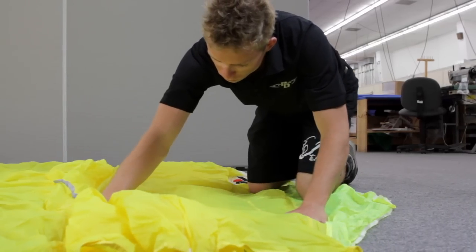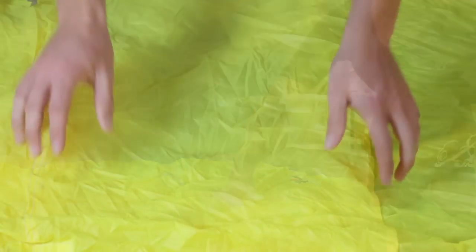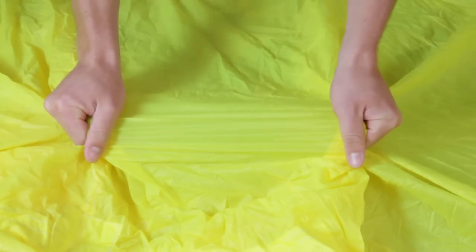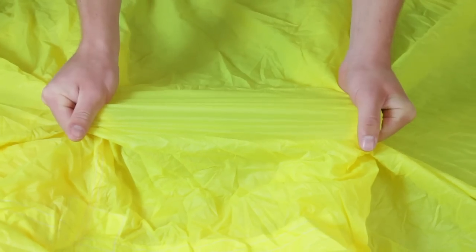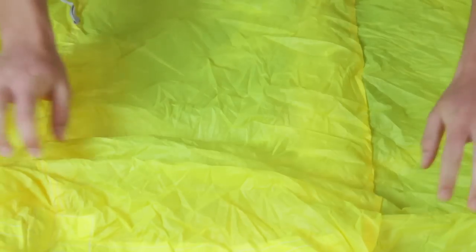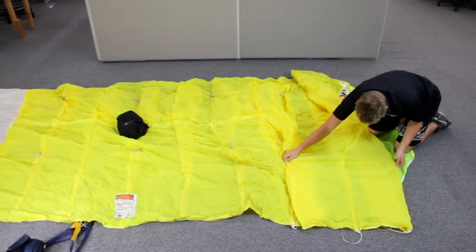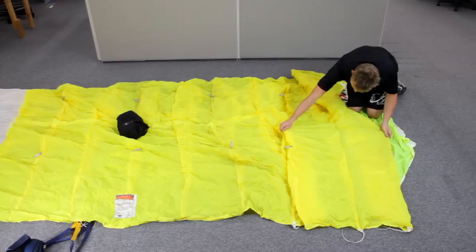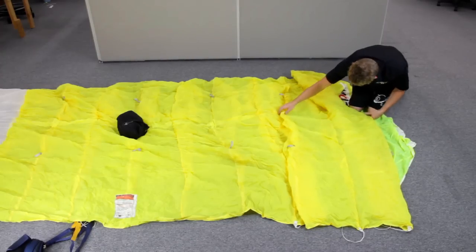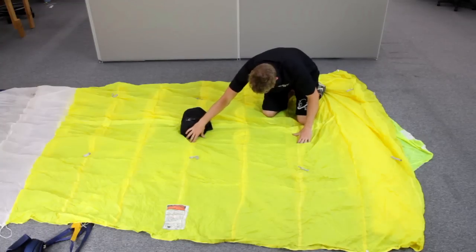Be sure to move across the top surface slowly and carefully. Periodically check the fabric strength by gripping fabric in both hands and attempt to tear it with a moderate tug. This is especially important in areas which are discolored, faded, or suspected of being weak. After you have checked the stabilizer, visually inspect from nose to tail or tail to nose across a complete top skin, then move to the next skin and repeat in reverse order.